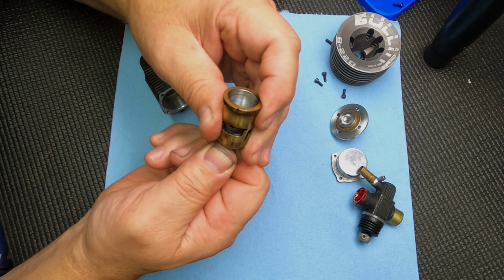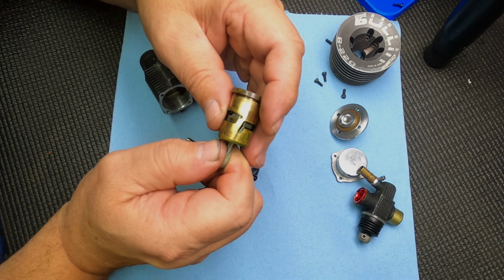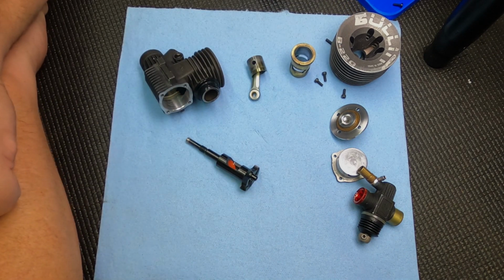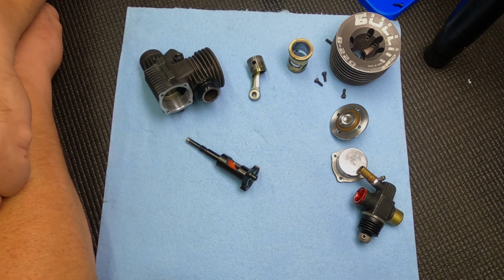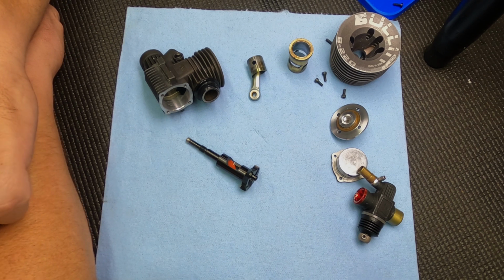When I pinch, I don't usually over squeeze them where you need to do a big break-in process. I try and get them like they were after a gallon. So I just recommend preheating and running a couple tanks easy after I do a sleeve resize. So it doesn't need a full break-in. I almost would rather have a resized sleeve versus a new one if someone gave it to me, because I don't have to do the long break-in process.